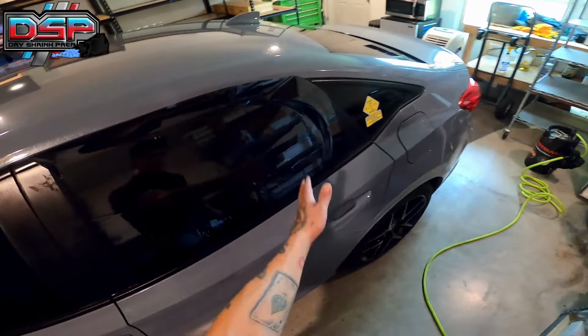That Y, right in this area, is not going to shrink correctly because, as you remember in the film video that I had, the direction of the shrink is very, very important. The film can only shrink in one way. So we want to avoid that Y, but we're going to bring our finger right down the middle and split it up. Now there's no Y, and then some of the other fingers on the sides will get a little bit bigger because of that. And that's really what we want. Now we're perfectly set up for shrinking.